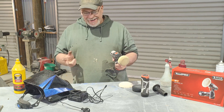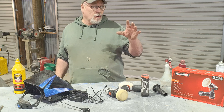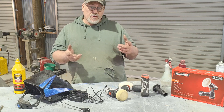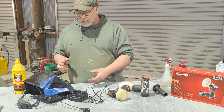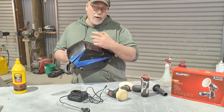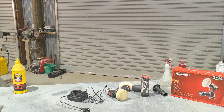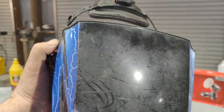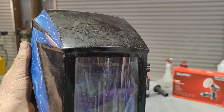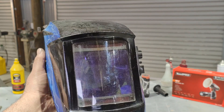One of the big things I use it for — and it's probably not something you'd think of — is if you're doing a lot of welding. I do a lot of panel repair so I could be two or three weeks doing welding, then into bodywork and paint and assembly. When I'm doing a lot of welding, the lens on your welding helmet gets grubby and dirty. It might not have burn holes or anything but it just builds up with scum — you know, from the welding gases, fumes, dirt, and burning off. So every day or so I run over it with the buffer.